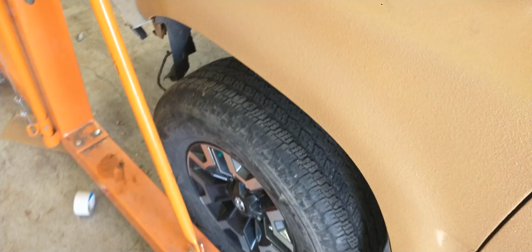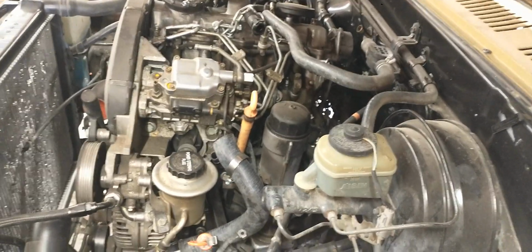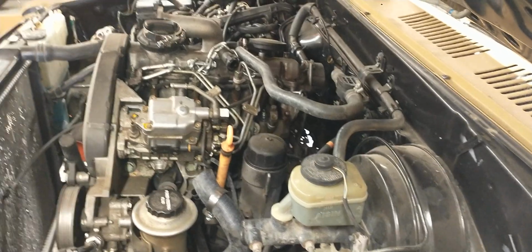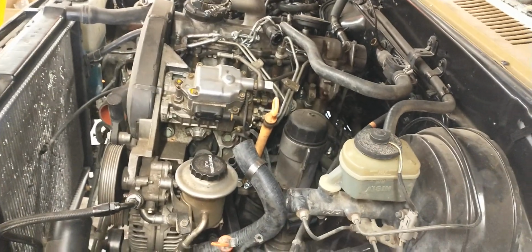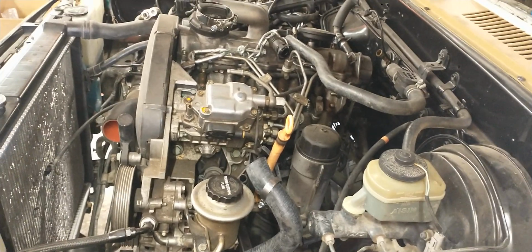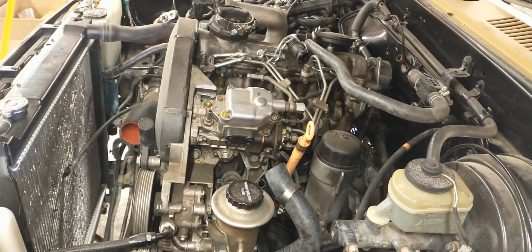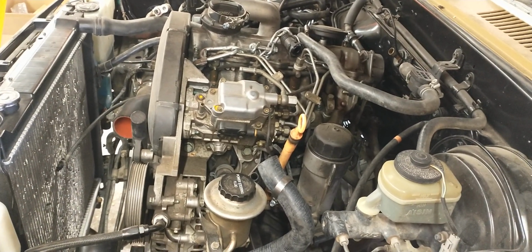But anyway, that's kind of where we're at with the Toyota. Hoping to get this thing fired up soon, but we are going to build a new wiring harness for it. And then I think we're going to play around with, I know a lot of guys on the AW4 in the Jeep have just pulled the TV cable almost tight for maximum line pressure, and that has proven to be, I guess, fine for longevity of running that higher line pressure and firmer shifts. And then they don't even need to make the pedal mount like I did on my Dakota, which, I mean, it's not that big of a deal, but it does make it pretty sloppy shifting normal, which, I mean, my wife doesn't care, and it makes for nice smooth shifting.